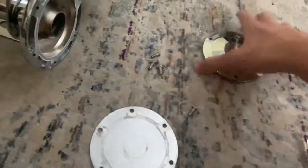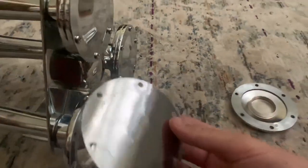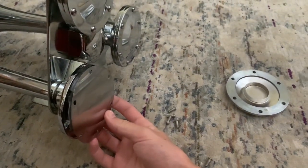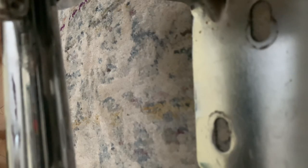I like to line it up with the little hole on the back cap right here — this is from when it was manufactured, looks like a casting hole. You can sometimes see it on the back cap. This was the side that sat in the back cap originally. But when I wanted to flip it around, you just simply flip it to the clean side and line up the screw holes. I'm going to put my phone down for a second so I can put this on. Again, make sure it's lined up, and all you need to do is put in the back cap just like that, then start threading in the screws, making sure they're lining up with the holes in the diaphragm.